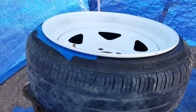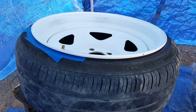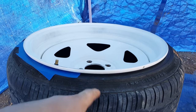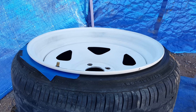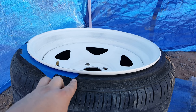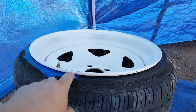There are quite a few different ways you can tape off your rims for paint. The easiest way is probably just to get a deck of playing cards and shove them in between the lip of the rim — that would work. But on these ones there's too big of a lip, and I'm going to a different color. If I was keeping the same color white I'd just do playing cards, but we're doing a color change without taking the tires off. So we'll get tape, two to three inches, put the top of the tape against the rim and slide it down as far as you can.